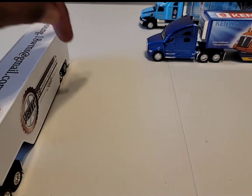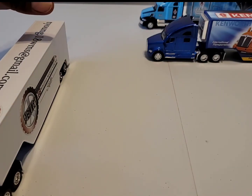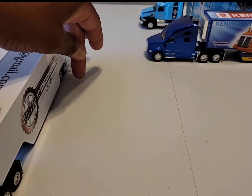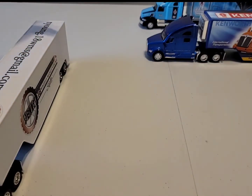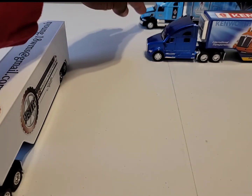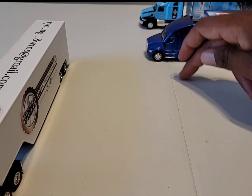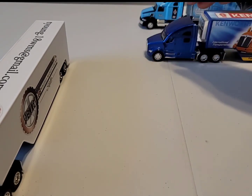Okay, back in the days, we slid our tandems all the way to the rear. That eliminated the tail swing of the overhang of the trailer. That's what gets a lot of people in trouble when they start watching the tandems only. If the tandems are slid forward and you've got all this extra trailer swinging in there, you're watching your tandems get by, but meanwhile, you hit someone's vehicle. So it's very important to have the proper spacing. Now, if your tandems are not to the rear, again, put them in the center of the space in front of the first truck or trailer.